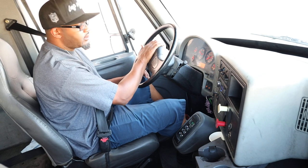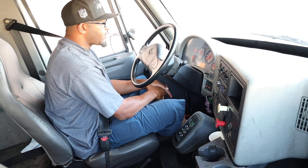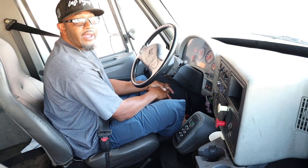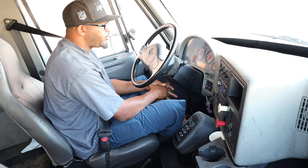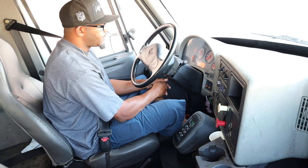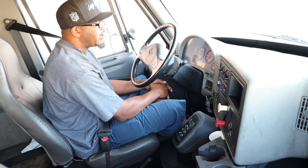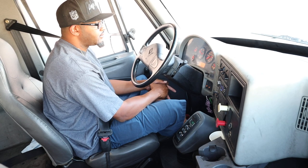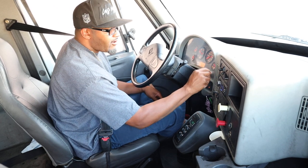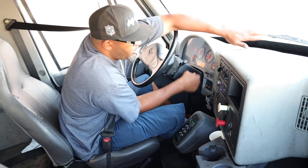I have my city horn and fog horn — working properly. We're waiting for air to build back up to between 110 and 120, never over 130. Also, let me get my heater and defroster — it's working properly as well.